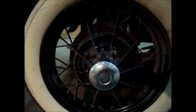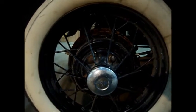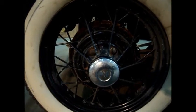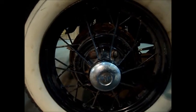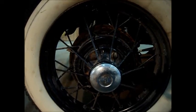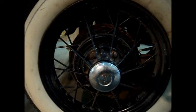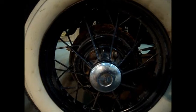So that was the one part that I had to fabricate. And I installed the wheel on the other side because that was the last one I put together. And when I installed it, it fit snug and tight. But because it's not a factory-made piece, it's a custom-made piece, and I felt I had a little bit of liability on it being the maker, I put a tiny tack weld on it so that it could not come off. It can be taken off easily with a cold chisel. So I intentionally did that so it could come off easily, but I didn't want it to come off during operation. I don't think it would anyway, but that little tiny tack weld I put on there was a little bit of insurance.